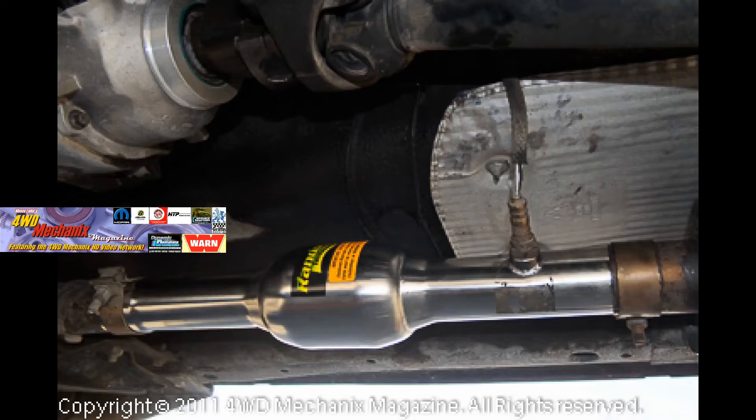The exhaust system was modified with a Revolver header from Banks Engineering, a Magnaflow muffler, and the cat-back system from Magnaflow, plus a Random Technologies catalytic converter — all detailed in the build list accompanying this video. The cylinder head was ported and match-ported to the Revolver header at an 8.7 to 1 compression ratio. The camshaft choice was the Comp Cams 252 grind, which Tony Hughes also agrees is one of the best choices for this engine. The only additional modification was Ford 5.0 liter injectors rated at 24 pounds, versus the stock 19 pound injectors.